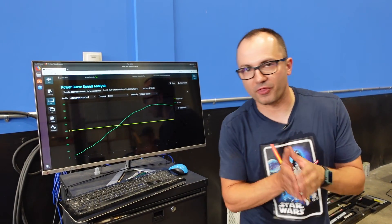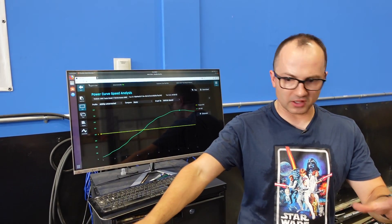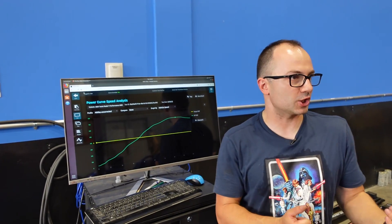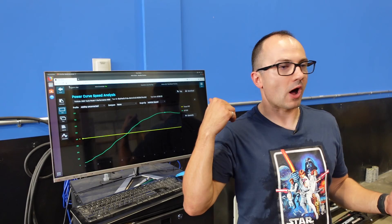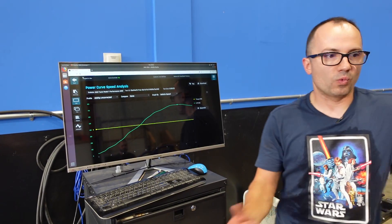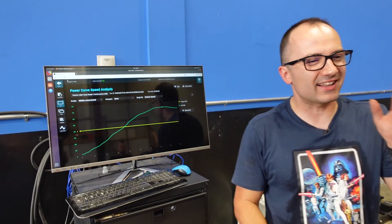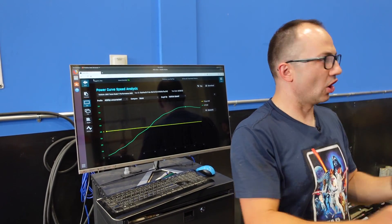Here are a couple of thoughts on that. First of all, we could not do what's called a load loss cal. Whenever you put a car on a dyno, the frictional losses between the drivetrain components, the rollers, and the wheels account for something, and you want to add that back into your calculation. The way you do it on a car with a gas engine is you drive it up to a certain speed — 85 miles an hour — drop it into neutral, let it coast down, and measure how much resistance there is. On a car like this, we couldn't put it into neutral and we couldn't turn off the regenerative braking. So no load loss cal. For such a heavy car at this speed, I expect at least between 50 and 70 horsepower was load loss.